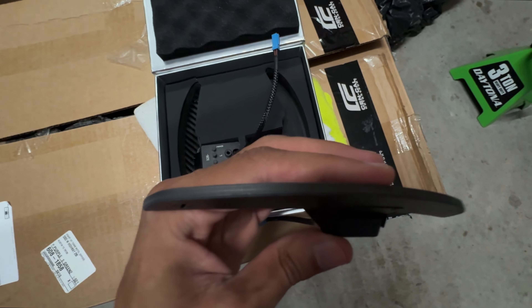Let me get this off — it's tight. You don't even need to undo it all the way, just until it's loose enough, then grab the cable and pull it off. Be very careful — the whole car will cut power. We wrapped the terminal in a towel so it wouldn't touch anything. Now we just let it chill for a little bit, let all the power drain out of the car, and then we'll be ready to pop this airbag.